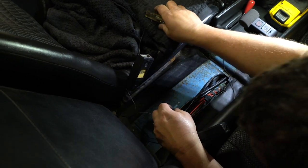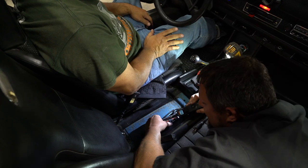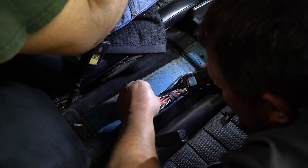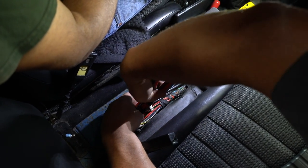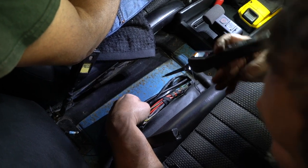So we're just gonna crimp this in. I'm gonna tie it in right here to this little screw. So what we're doing is I'm just gonna use the power probe, and I'm actually just gonna pierce this one. Ow, my finger, or the wire, I don't know which one. And we're gonna just get this. Actually, a better option would be to just take our strippers and scrunch the insulation back a little bit.